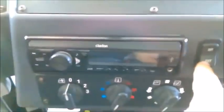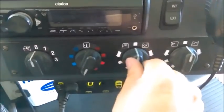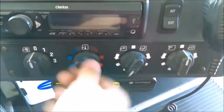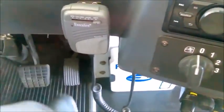I have an interior/exterior PA—I check that the light works. My two-way radio I check every day. I have two vent control knobs—outside and inside circulation. I set the defroster control and check thermostat on levels one, two, and three—I make sure I feel all the air coming up at the windshield. I also check the throttle and service brake pedal; they're in good condition with nothing behind them that would impede proper use.